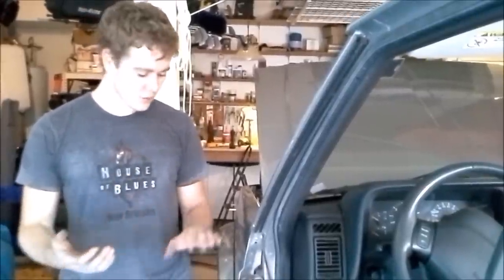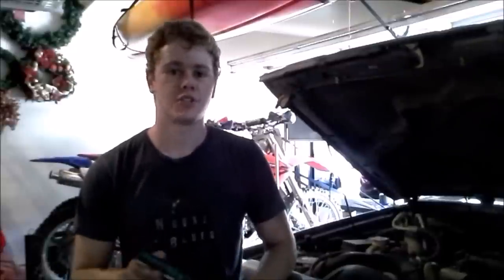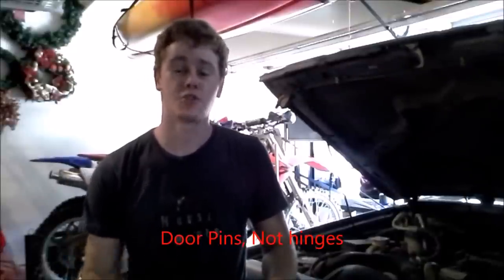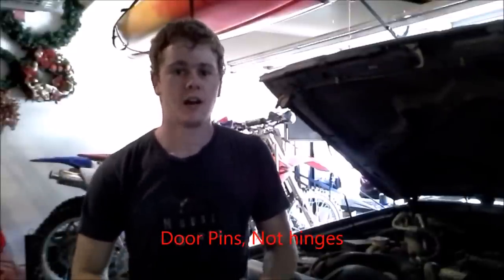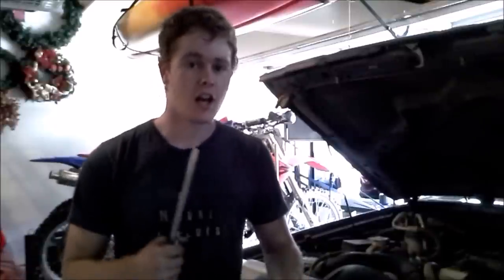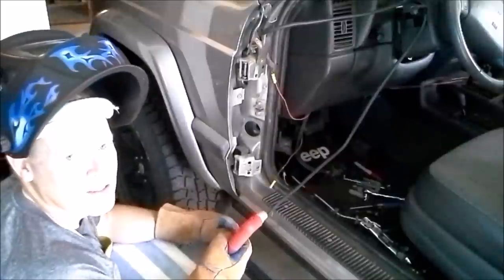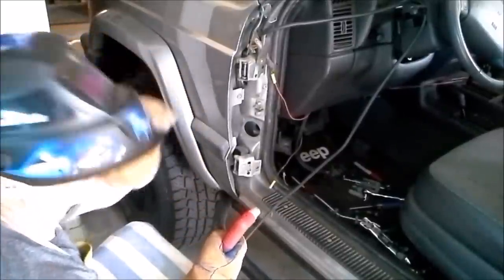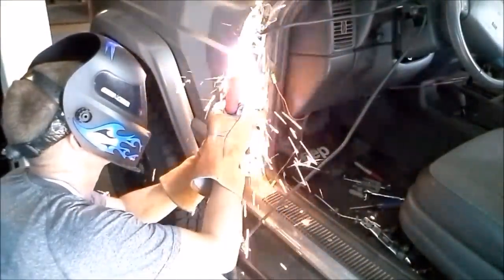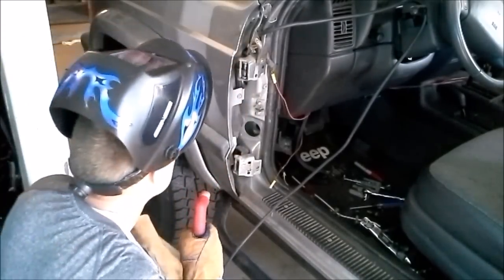Now we've got the doors off the hinges. We're going to cut the hinges from the body — there's one pin that holds it in and that's what we're cutting now. When you go to cut off your door hinges you can do it a couple of different ways. I've heard of people doing it with a Dremel tool and a cut-off wheel, but we have a plasma cutter and we have more plasma cutters than we do patience. Before you do any welding or plasma cutting on your vehicle though, you want to make sure to disconnect your battery. Now we're doing this the easy way — plasma cutting the bolts off. Done.